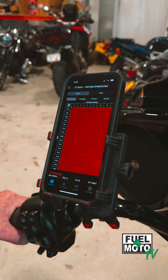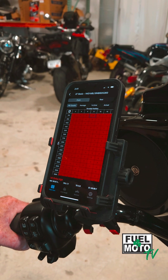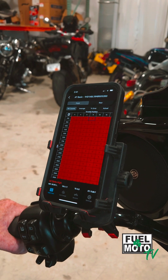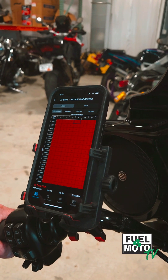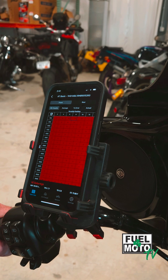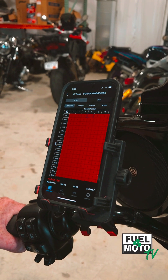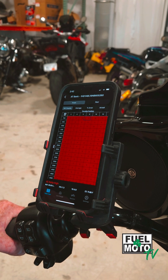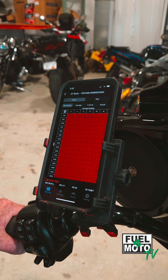We're going to run this bike — take it down the road through the industrial park, put some time on it, and come back and show you what the data looks like. When you first start the bike, it will need to fill in data. You're going to see some errors at the bottom such as 'has not met engine temp' — that's normal, because the bike has to get up to engine temperature and meet certain parameters before it starts building data. Once it does, it's going to build really good corrections and fill in the histogram.